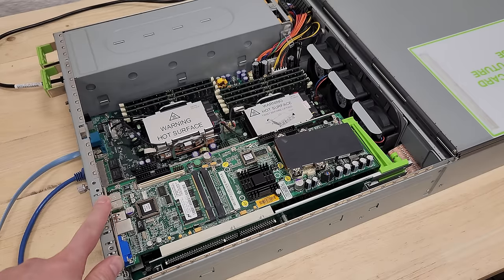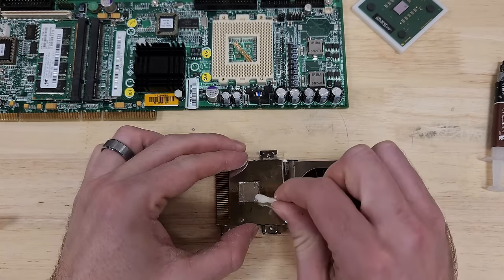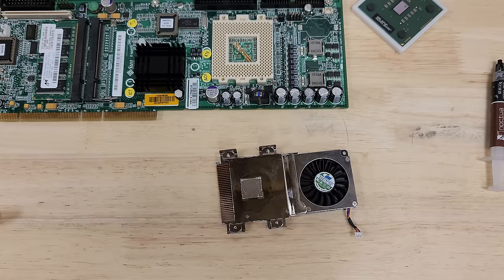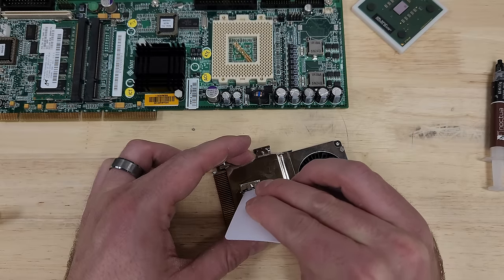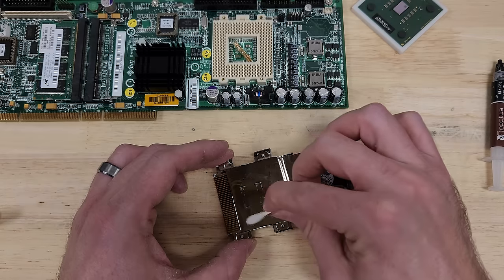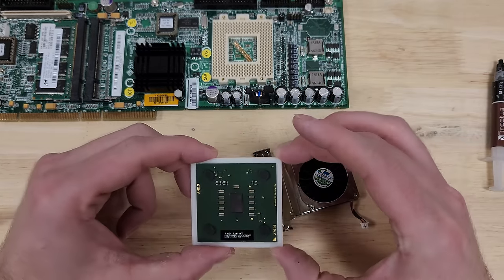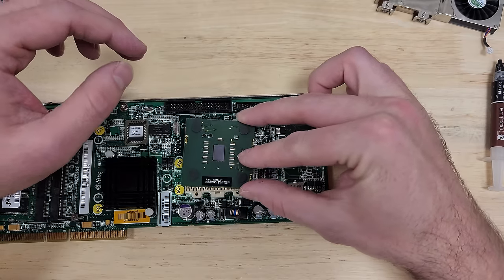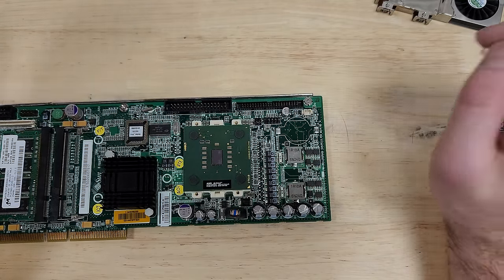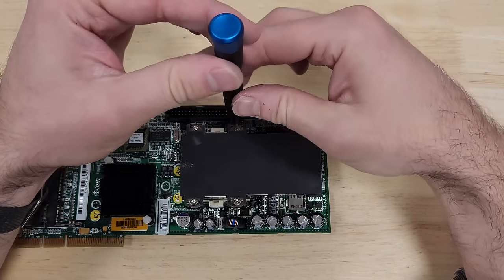Let's get it back in. We'll boot this up and try to talk to it — what we should see is the same hardware failure, then we'll get the other CPU in. First, we'll need to get this old thermal pad off of here. Try to loosen it up with IPA. I've seen people use guitar picks, which is probably what I need. I don't have any replacement pads, so we'll have to use paste, which I think is probably fine. Let's install our victim. Which way does it go? That's going to make a huge mess, but better safe than sorry. Screw it down.